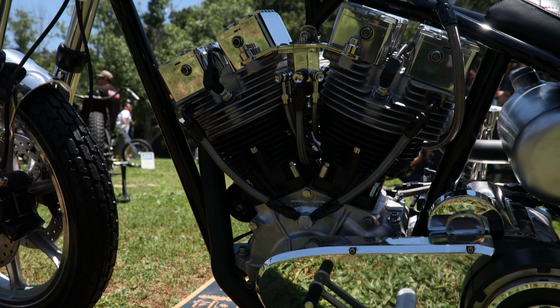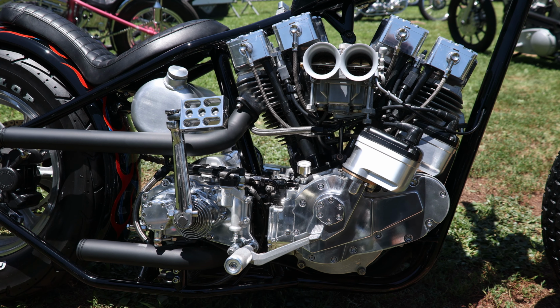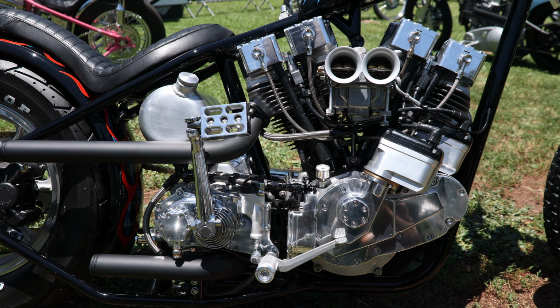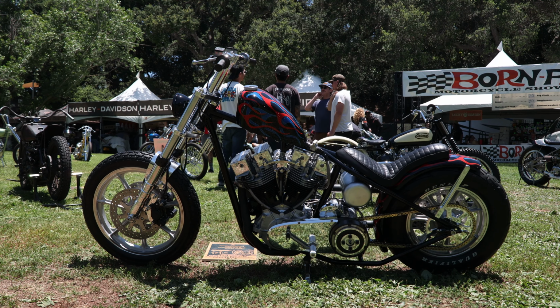The external oil drains from the top end, that's basically an old Indian Larry thing. Somebody probably did it before him. It's probably an old drag bike mod. And basically, it's cooler oil. The oil isn't draining through the cylinders like on a standard Shovelhead. So the oil drains externally, cools the oil. There's a few other things about it, being big bore cylinders and that it has advantages, but yeah.